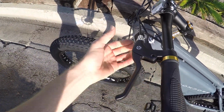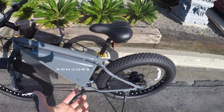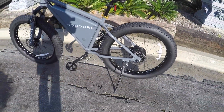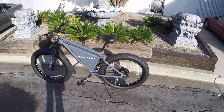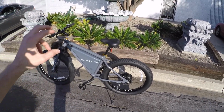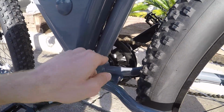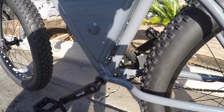They do have motor inhibitors, and that's good because this does use a cadence sensor, and it's actually much more noticeable than on the first Indiegogo bike. I completely missed it on that bike. I said, oh, it doesn't have pedal assist, and that was part of the whole range question. How far can it go? And yeah, if you use their very gentle pedal assist, it's got an 8 sensor disc down there, so 8 little magnets that pass the cadence sensor. Pretty nice, pretty responsive.